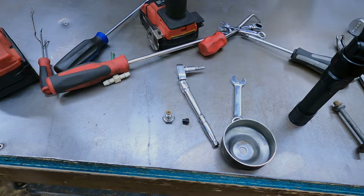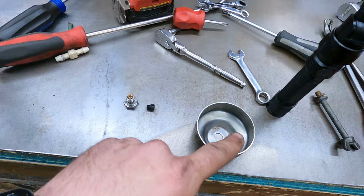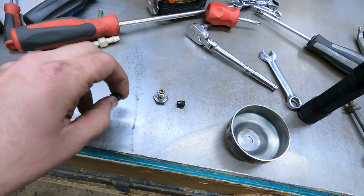This thing runs pretty shitty actually. So when I was trying to make it quit leaking gas, I noticed that it was missing one of these rubber things that go up in the next to the emulsion tube. And I made a mental note of it and forgot all about it because I was more worried about getting it to quit leaking. And that's probably gonna make it run super rich. I'm pretty sure I dropped this down inside the motor when I pulled this off that last time.